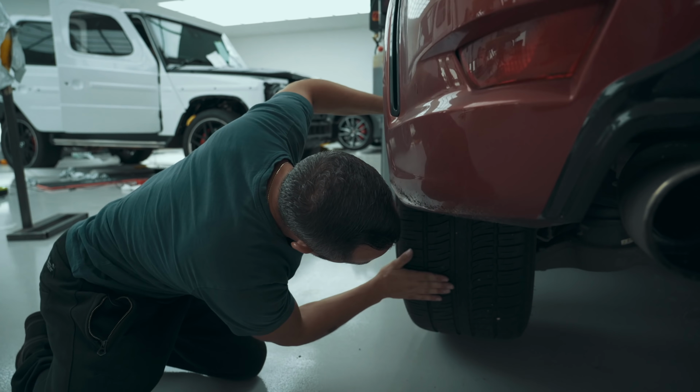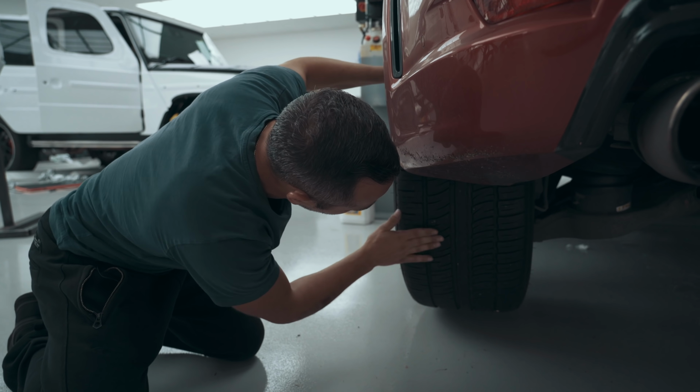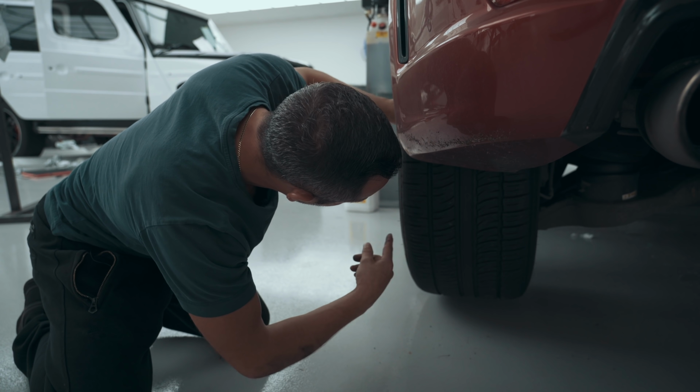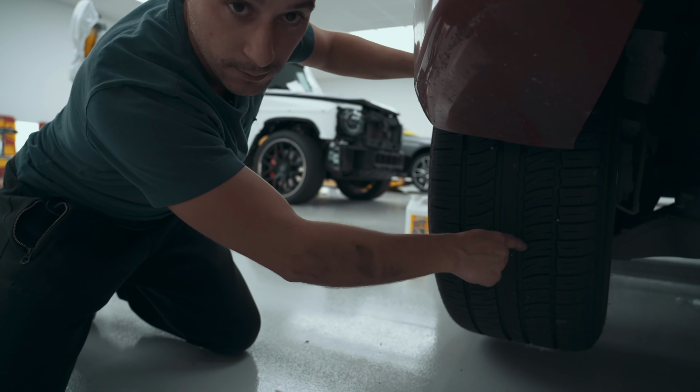We're going to look across the face of the tyre. That's nice and flat, there's no uneven tyre wear, so it's running correct pressures. But we'll keep on checking the treads, make sure there's no nails. Here we are, number one hit. You can see it's been in there for some time as it's worn the top of the nail.